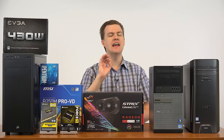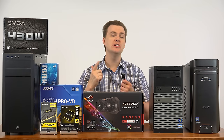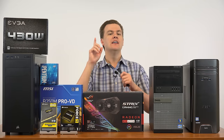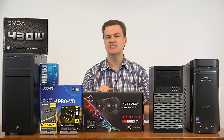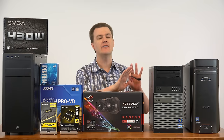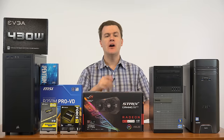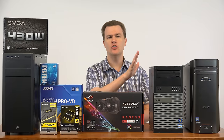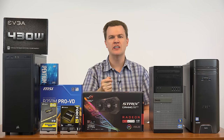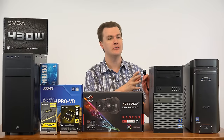A $35 power supply will fit into almost any mini tower pre-built you buy. Some Lenovos and older compact machines don't have standard motherboard power connectors and require an adapter cable — you can get those off eBay or Amazon for $10. Dells and HPs generally use standard 24-pin ATX connectors. The Dell Optiplexes are wonderful — I've had excellent luck with them. I own three or four now, and I use most of them for my office. For general office tasks at $120–$130, they're all we really need for Office, web browsing, etc.